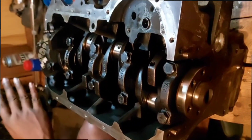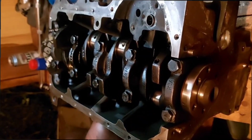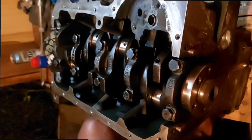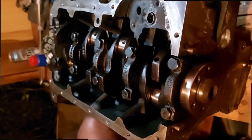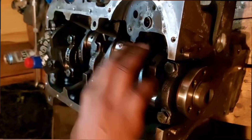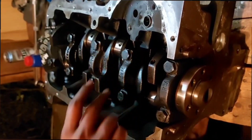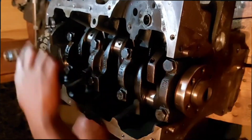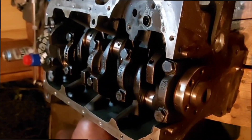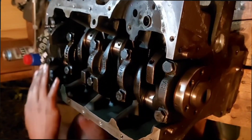Finally — I had to get my camera lady to help hold the block because when I was torquing it the block was moving on the wooden table. All the bolts are torqued down. Remember, we're starting from inside going out — so I did 1, 2, 3, 4, 5, 6, 7, 8, 9, 10. I suggest you do it that way. I torqued all the bolts to 65Nm and then double-checked — starting 1 through 10 — just to make sure all are torqued.